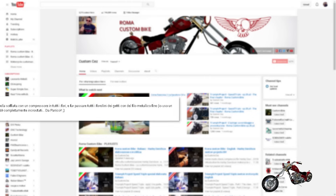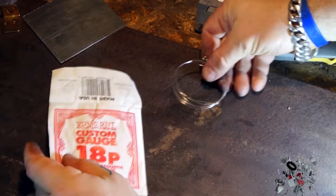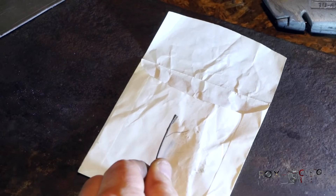One of the comments was from an Italian friend of mine, Steam Noise Garage. He suggested to blow each hole and every jet with some compressed air and to use a thin metal wire to make sure each hole is free from debris, gunk, or even cleaning products used in the process. I immediately thought that a used metal guitar string would be the perfect item, but probably a single strand of an old clutch or brake cable would be just as good.